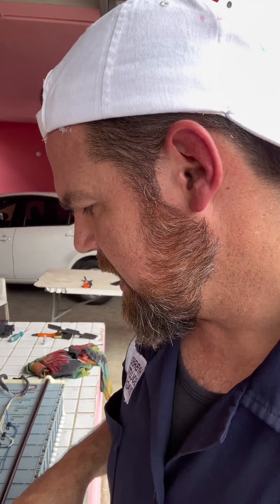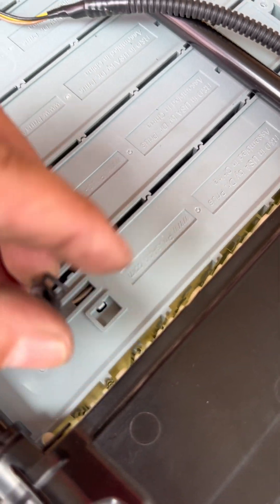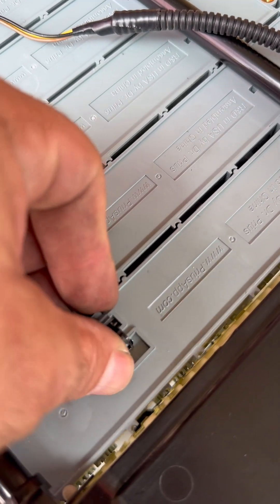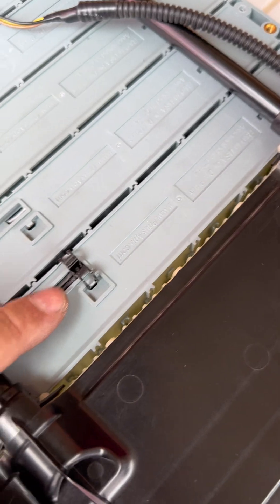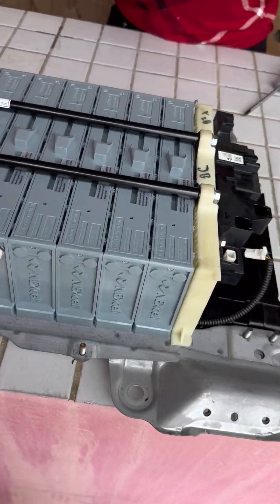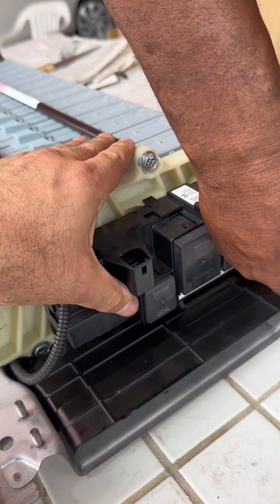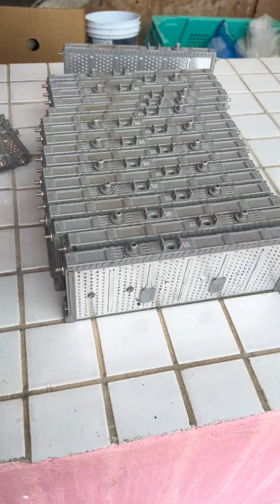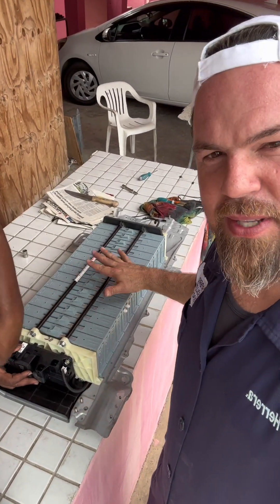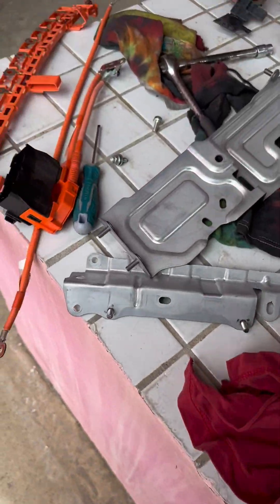Super important to consider: the temperature sensors in the fourth generation Prius and the Voxy, CHR are different because they don't go on the top clip — they go on the bottom clip. This is how they match the temperature sensor: totally different to the others, but they get very close to the cells. Temperature sensor number one, one in the middle, and the last one. Everything is supposed to match one single position. Now the Voxy with the NexCell lithium battery is looking impeccable.